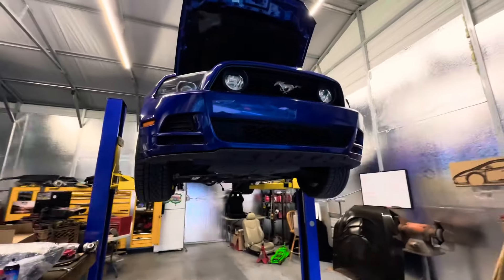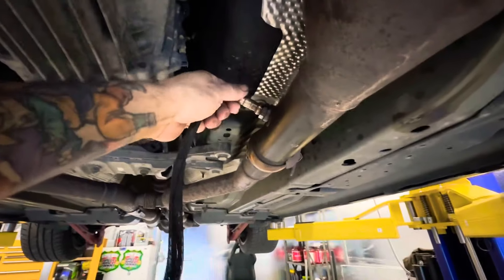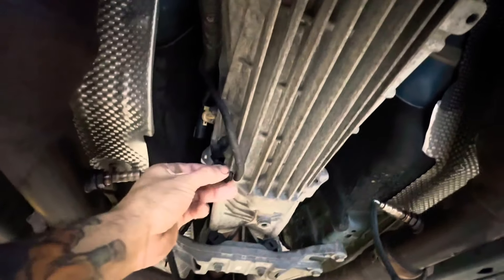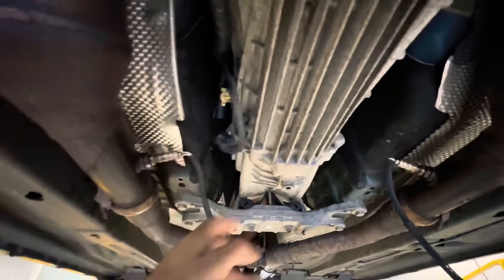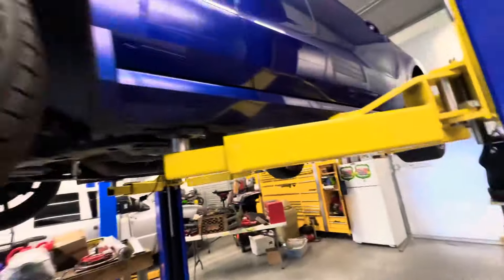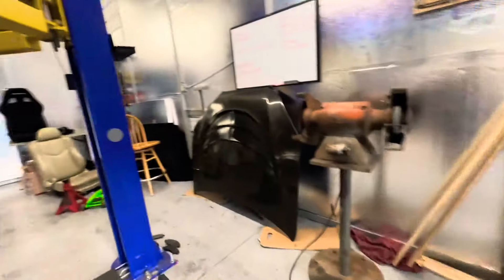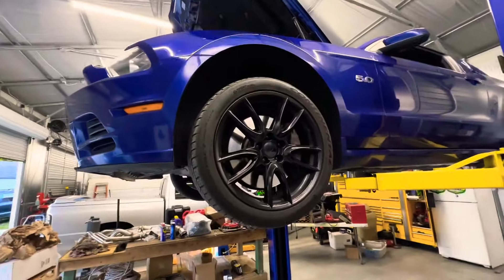So today's another day. I started to disconnect the O2 sensors and they're loose because I was loosening them with WD-40 — it actually worked on them. This is still soaking up a little longer. I disconnected the transmission here as well because we're disconnecting all these wires to get them out of the way. Now I'm gonna lower the car to show you guys what we gotta do next, which is get to those motor mounts from the top.